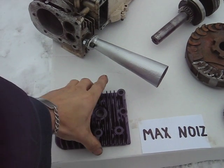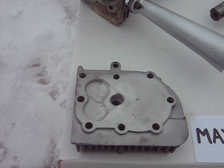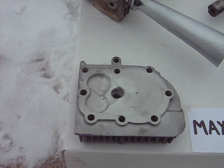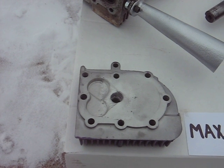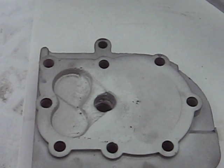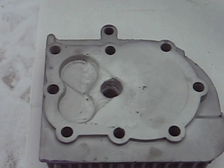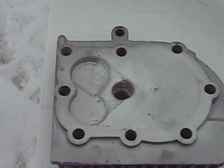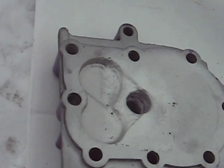Here's our one main component: a high compression cylinder head. You can see my friend at ACDC Welding did a lot of building up to increase the compression ratio. We got a little bit of porosity in it, but that's not really his problem. The engine components are made of aluminum — they're difficult to weld because the oil gets right in there. He did everything he could to try to get it out, and in the end he did a really good job. I'm really pleased with it.